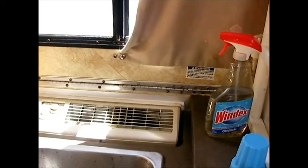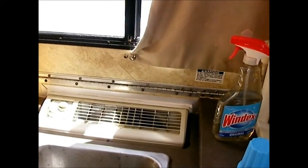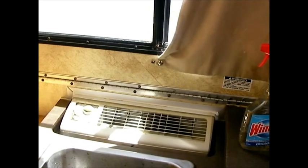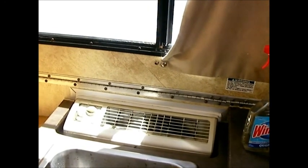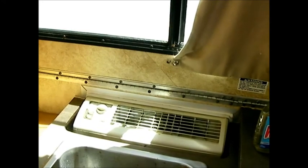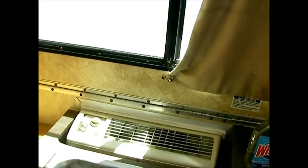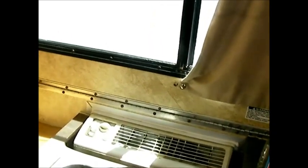I'm going to use a second jug of water to rinse it out thoroughly. After letting it dry out a little, we try it again. I'd say it's just a little bit better after doing that — not a huge difference. I think the filter was the main issue, but flushing out the coils did help slightly.